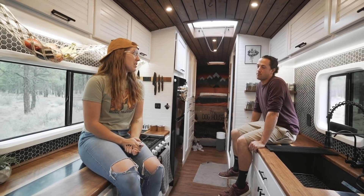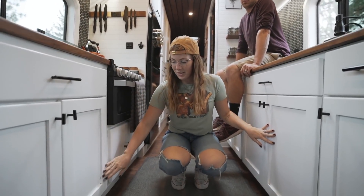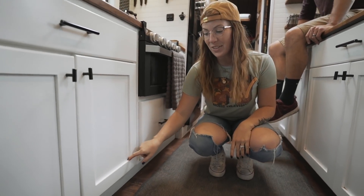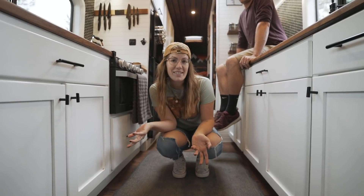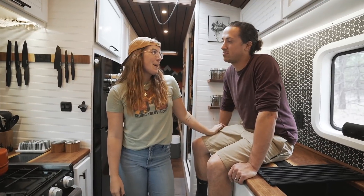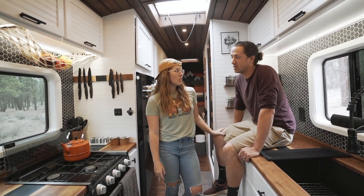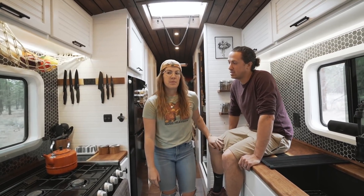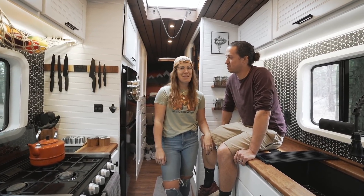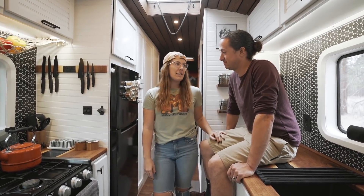Advice we'd give to anyone about to start a build: you think little details like these decorative cabinet doors are cute, but in reality they just catch dirt. Just do one straight piece of wood and don't worry about the details — or maybe paint them brown instead of white. That's my biggest piece of advice. If I had to change anything, I probably would have been a little pickier on the bus we bought — it had a less than desirable transmission. We had the AT545 and actually ended up swapping that out right before we left home for a 2000 series. When you find a bus for $2,500 and think it's a great deal, don't necessarily just jump on it.